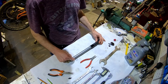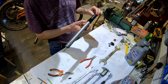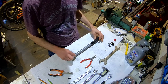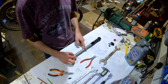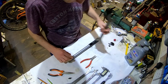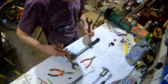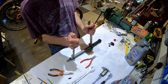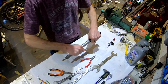You've got some flats to put a spanner on, and obviously a hex face to put a spanner on, and another hex face at the bottom. First thing to do is separate the diaphragm portion from the lower portion. As always with RockShox they've used unusual spanner sizes - this one is 25mm, this one is probably 21mm but a 7/16th Whitworth fits perfectly - and you just want to undo that section. There's usually loctite here.